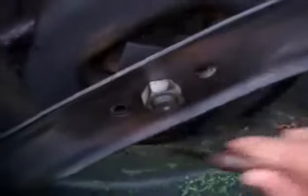Oh, unfortunately, I ran out of gas. I just turned the lawnmower upside down. You can see where the crankcase is. It's not wet, which is actually a good thing, so that means the crankcase seal is not the problem, but you can probably see the excess carbon inside the muffler, so that's probably the reason why it's behaving the way it is. I don't really use it particularly too much on my customers because I already cut the grass and it took around 3 refills.